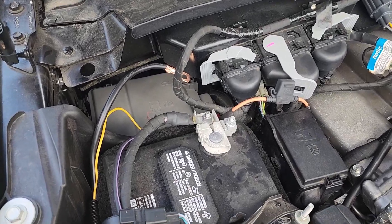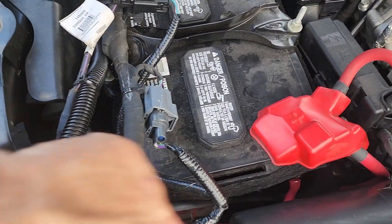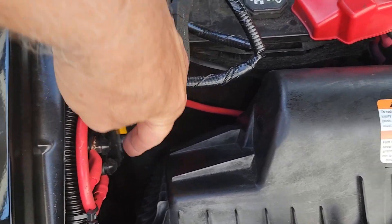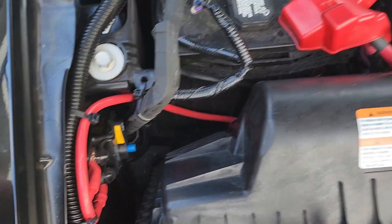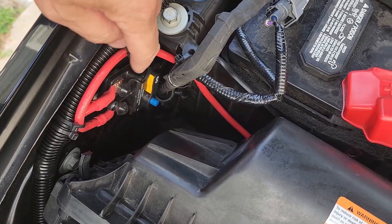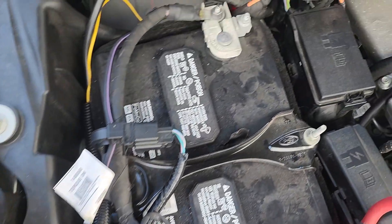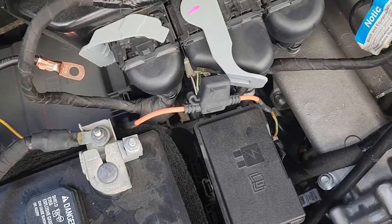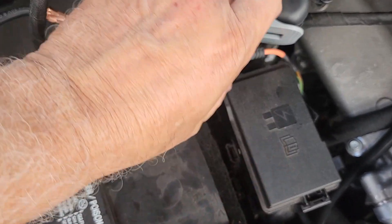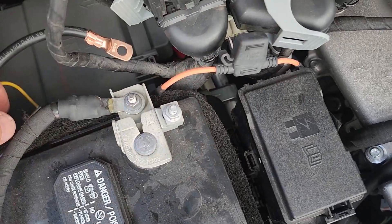We're almost done with the wiring for the truck and the trailer. I have my negative cable going to the back — haven't hooked it up yet — and my positive cable laying here. I also mounted a 60-amp circuit breaker to the side of the truck. I'm going to use my auxiliary switch to turn the charger on and off. The factory fuses are either 20 or 25 amp, so I put a fuse link in here with my own 5-amp fuse.